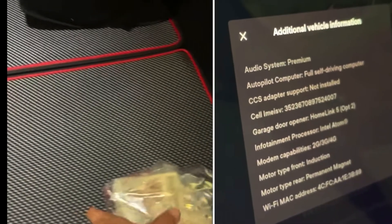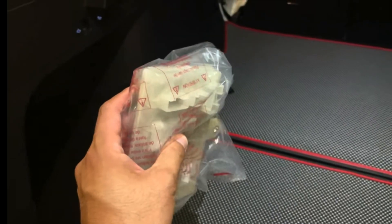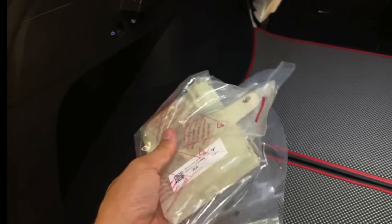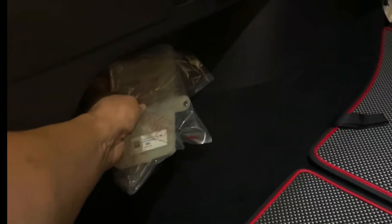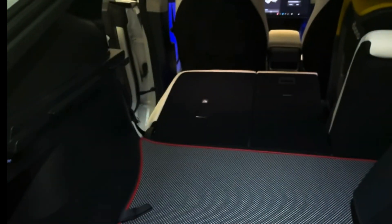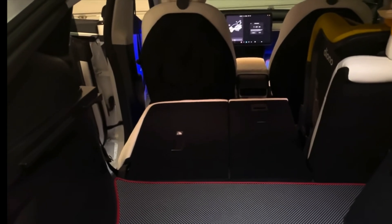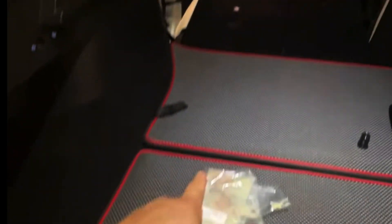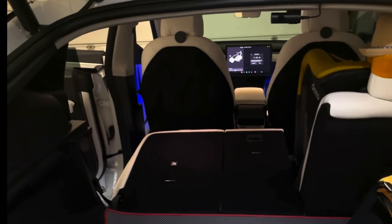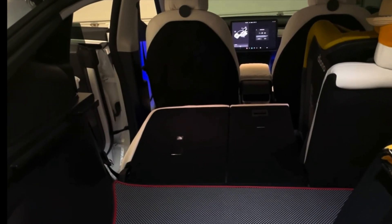If you don't have CCS enabled, you will have to get this retrofit computer. It's a swap, unplug-and-plug-play device. For the Model Y it sits back here; for the Model 3 it sits over there. After switching it out, reboot your car. Make sure you're able to reboot it — if you have a software update, hold off on that until you switch this out. Or you can do a service mode and reinstall the current software.